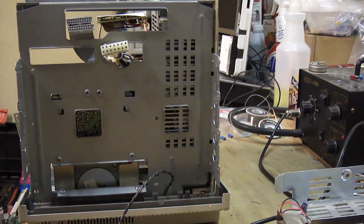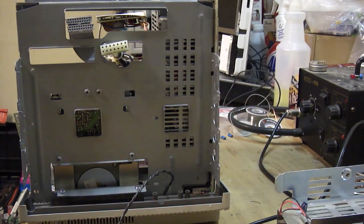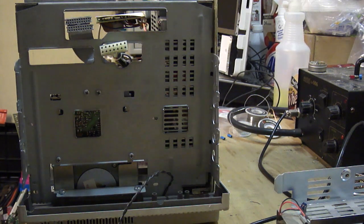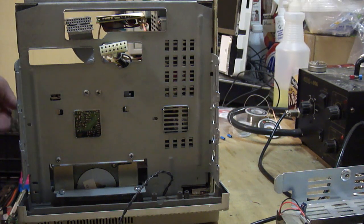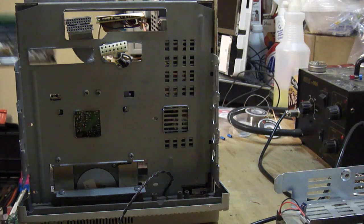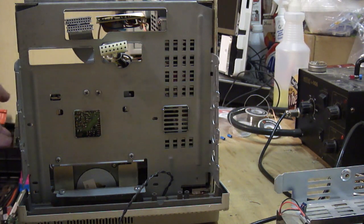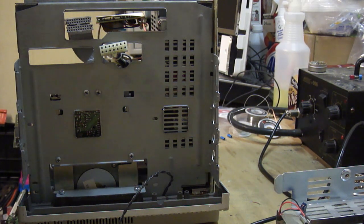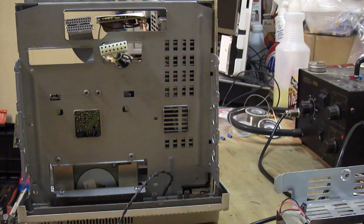Yeah, I finally got a tripod so I can do these videos a little bit better. Anyway, before I can wrap up this revival series, there's one other thing I got to do. I got to test all three of these boards to make sure they're going to do a system install to the hard drive from the floppy drive. So basically I test a floppy controller and a SCSI controller all at the same time. Plus while I'm in System 7, I can go in there and play sounds or whatever, make sure the sound hardware is working correctly.